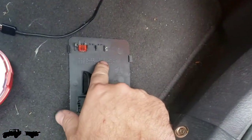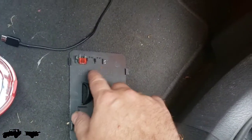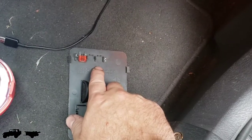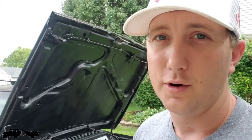I checked all the other fuses and they seemed fine. Check the door behind your fuse box panel for extra fuses — it was handy to have them there. So the quick tip: if your dome lights aren't working, your instrument panel is out, and you don't know what to do, check that 15-amp fuse first before ripping your dash panel off. Hopefully that helps. Good luck guys, take care — see you in the next one.